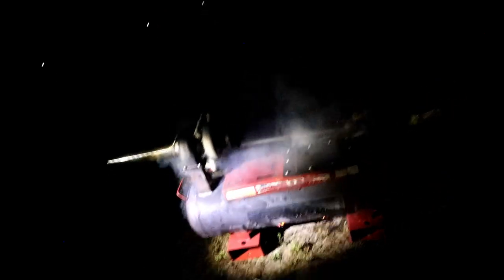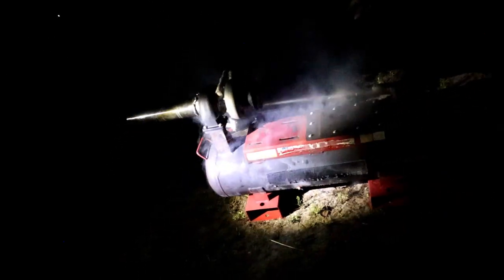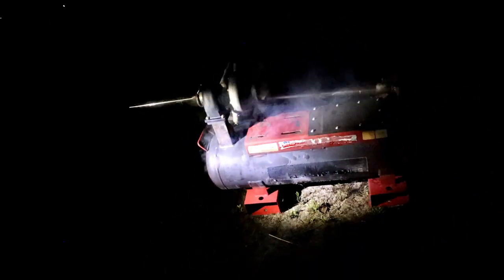I think another good thing to do would be to have something, like Matthew was saying, like having a wastegate. Well, I was saying we should put a wastegate on the intercooler piping and feed it into the dump. Something on the vessel. Yeah, because if you put a wastegate on the piping into the dump, you can regulate boost. Yeah, but at least put a 10-pound spring in it. Yeah, you can. It's not going to destroy that tank.